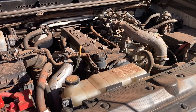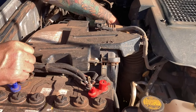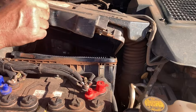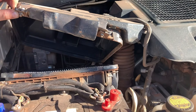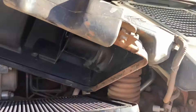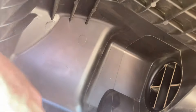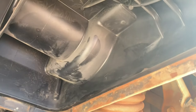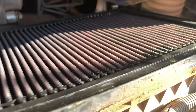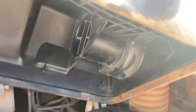At the K&N - there are two K&N air filters. This is the 120 Prado and it's had the K&N in for the whole trip - no filter's been changed. Was it clean at the start of the trip? It wasn't clean since before the last trip. There's a bit of dust here - run your finger up on that part, higher. That top part is clean - so no dust there. But there is some getting through this one as well.